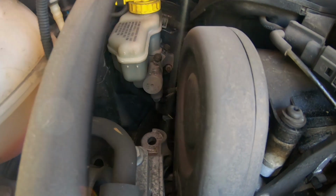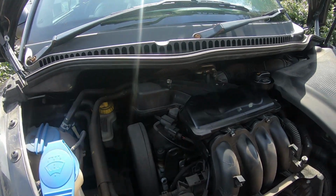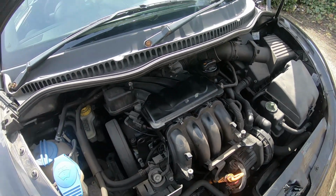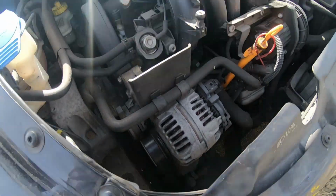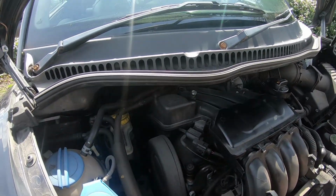But yeah, I would think the clutch is probably worn with the biting point being high, so that's going to be a gearbox off job. And then there's a worry if it has a dual mass flywheel. Got that to contend with, and that's more cost. That'll double the cost, because the dual mass flywheels are not cheap.